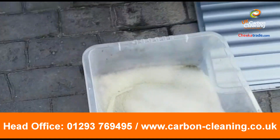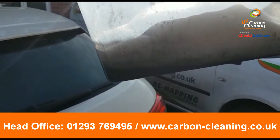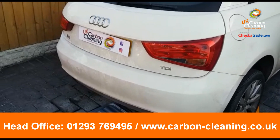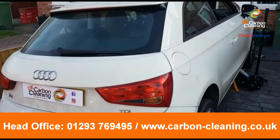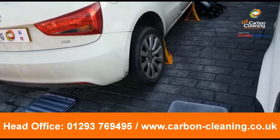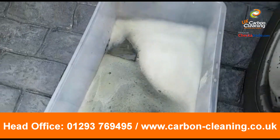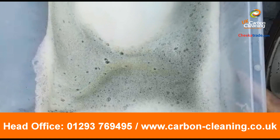We've just finished up on the DPF clean and flushed out. You can't really see that too well, but that's basically all the stuff we managed to get out of the DPF. This one was pretty bad. We're going to go for a little test run now. There's actually no fault code showing on this one at the moment — it doesn't trigger a fault when the pipe's disconnected, which it usually does on most vehicles. However, we're going to reset all the sensor data and the DPF anyway, just in case we've interfered with anything along the way. It's a pretty successful clean — have a look at all the black soot coming out of it. It's crazy how much soot actually gets caught in these things.